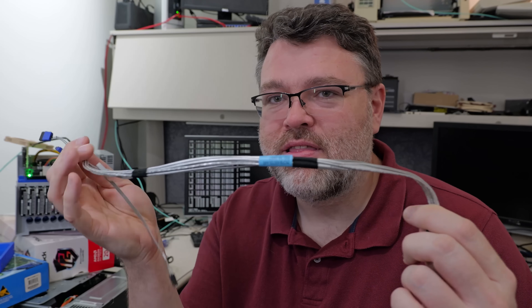You can plug in a cable with a square connector on one end and four SATA cables on the other and run eight or nine SATA hard drives. The problem is that eight or nine SATA drives, even SSDs, are not going to push eight gigabytes per second. And I was so impressed by the performance, I wanted to see how far I could push this thing.